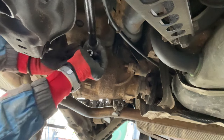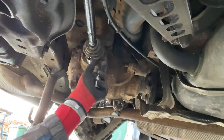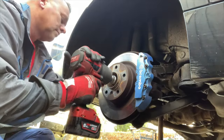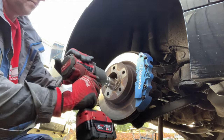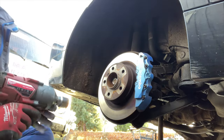My socket got stuck again on the rubber boot — turn the drive shaft around and it'll come off a lot easier. Here we go — let's whack this up. We've got it set to high, we're on 420 Nm, so we need to give this a real good pound and get it up. Super tight, that is.